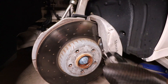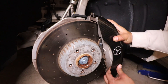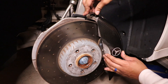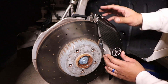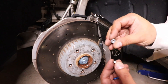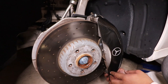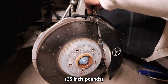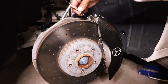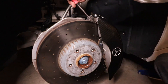The first step is to take the caliper cover and mount it flat against the stock caliper. Then take the bracket and slide it between the rotor and the stock caliper. Now I can install the two nuts and torque them down to 25 inch pounds. Then I use the feeler gauge to make sure the bracket clears the rotor. If it doesn't clear the rotor I can use a screwdriver and pry up on the bracket.